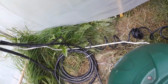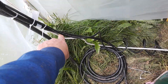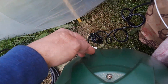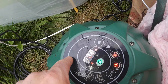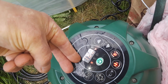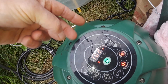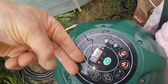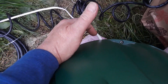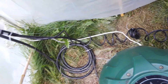In order to get the external pump to be commanded by the robot, I had to get its power from half an extension cord. The extension cord goes into the robot; the two wires connect on the bus where the pump wires would normally go — clearly noted by the pump wires you see coming up. Take them off and replace them with an extension cord like this, run it out through that reset hole in the side which is nothing but a rubber plug, and this will command your external pump.